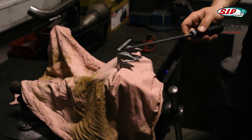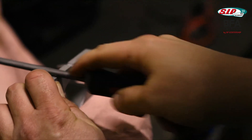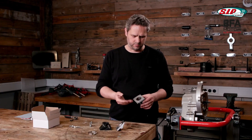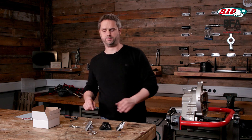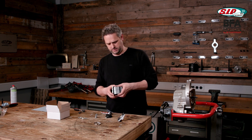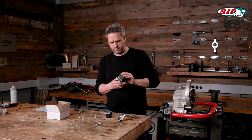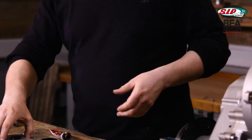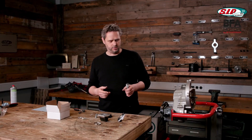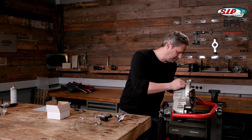I need to be careful here to leave enough sealing surface — that's a tight fit. The reed cage now fits, the recesses for the bolts are there, and now we'll fit the reed valve. Since this is a modified reed not originally intended for this engine, it's not simply using a gasket. That doesn't matter though, because we have a great and very clean gasket surface. And what's more important still, we have sealing compound — great silicone sealer — and that's what I'll use in between these two, because it is great for sealing gaps, and with that it will work a treat.